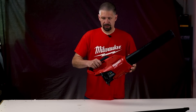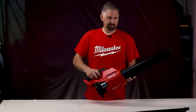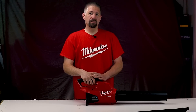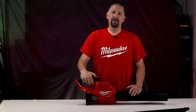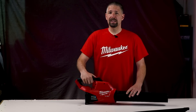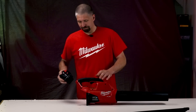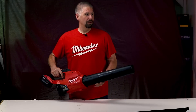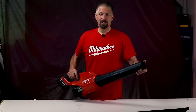There is a high and low speed setting, and a lock button so you don't have to hold the trigger down all the time. One thing I noticed is that you cannot switch between high and low while the trigger is engaged — you have to release the trigger, select your low or high setting, then pull the trigger again. So you can't change the speed on the fly, but it's not that big of a deal.